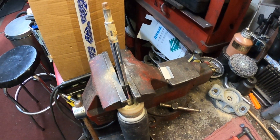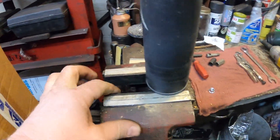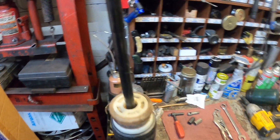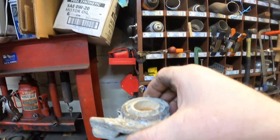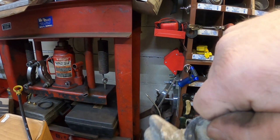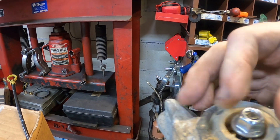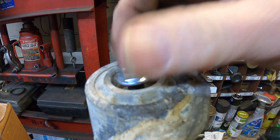Now I have this apart. Let me go get the new shock and set it up and I'll show you the special tool I'm talking about. I have the shock with my soft jaws in the vice, just barely holding on. Here's the problem — this is threaded and it's got like a double-D at the top. This is the adapter that goes onto the car, goes on like that, and then comes the nut. This nut doesn't want to start — I'm going to have to get a wrench to get it started because it's up too high.